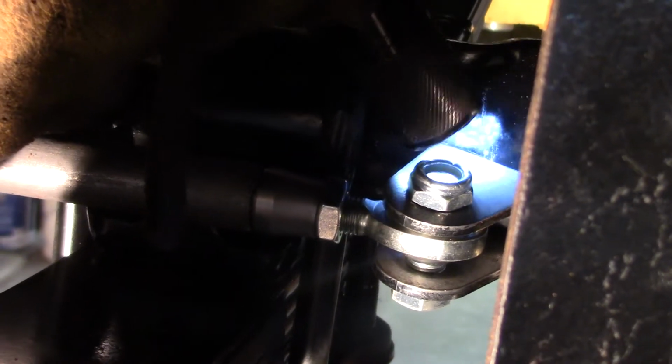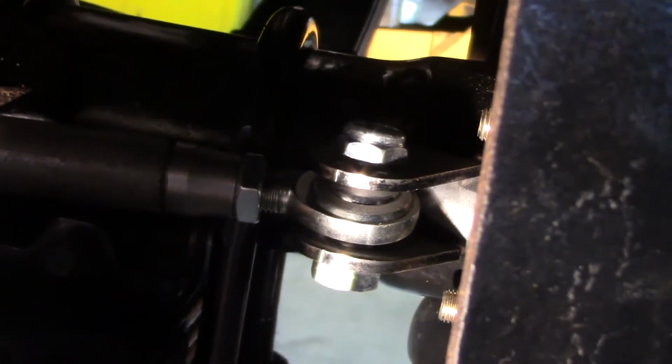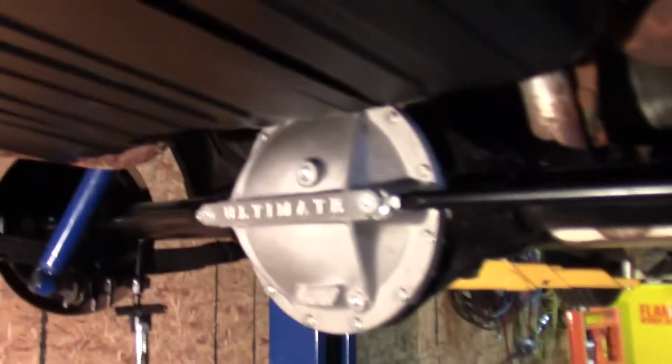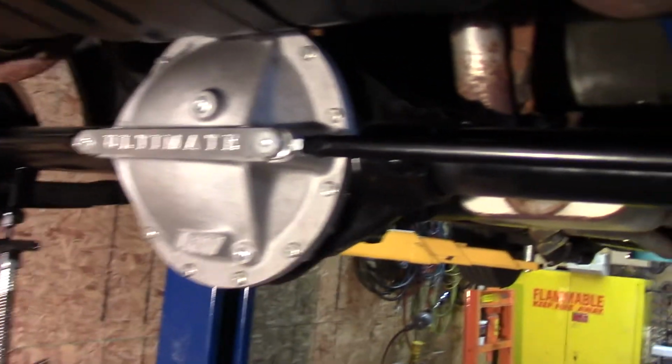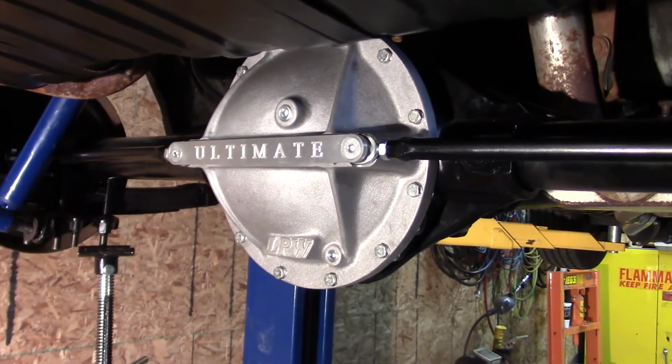We're going to have to take the little brackets and grind them where there's not a gap, because we're going to be welding this here under there. We want to do minimal welding here because the bearings are already in place. Right. So we'll just have to do a little and let it cool. Spot at a time. As we're fitting this up, I'm going to take a minute to notice here that we've used a low profile kit for this. Not really sure what the difference is.